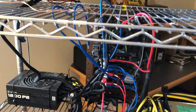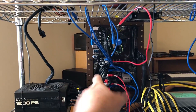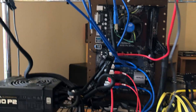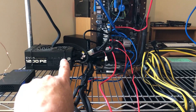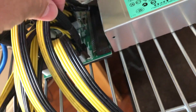The game plan is to put six cards hanging down here on the bottom. The reason I'm not doing seven on the bottom is that I need access down near the processor where the risers connect to the motherboard — for maintenance or plugging in USB. So I'm going to leave a space right there. The HP server power supply cables, especially with adapters, are going to be long enough to reach just about anywhere on the rig. I want to do a quick power-on test with no risers and no GPUs — we do have this power supply connected to the server power supply on the four-pin breakout board.